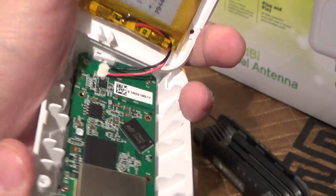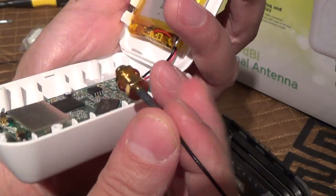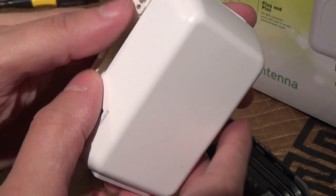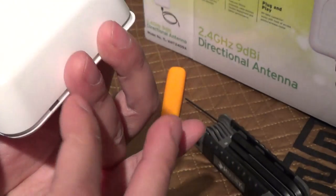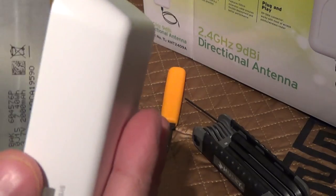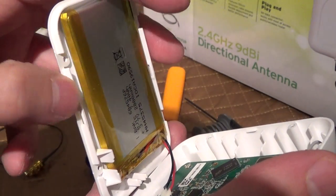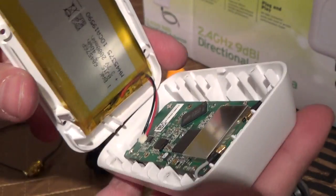I'm going to pop it out and put a hole over here for this to come out there, so it will be screwed in here. Getting the cover off is a little bit of a trick — you can pull either side, but there are actually clips in the middle here and here. What you need to do is carefully pry it up so that you can lift off of the clip that's holding it in, because the clip holds into this piece and on the bottom. You need to lift it up enough so that this clip goes over it to release the back cover.